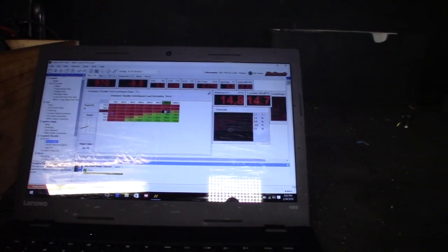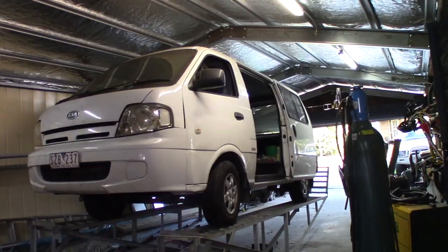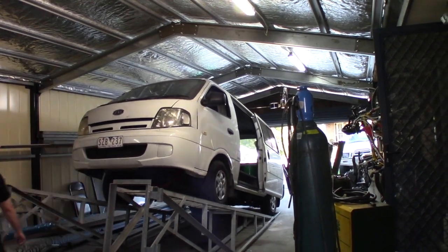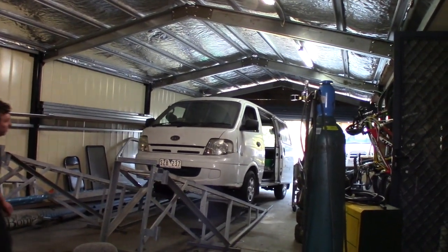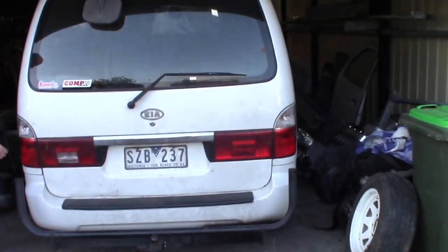How's that? You think the transients are better now? Better, but still a little bit lean on a quick crack. There we go. Still a little left hand now, but you'll be right. Yeah, you're on it now, you're perfect. Good. How'd you get it in there, Shane? I just let the tires down to get it in.